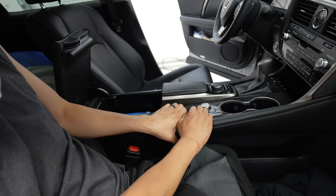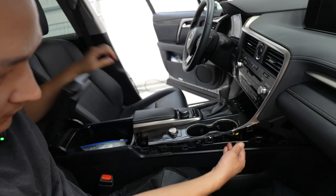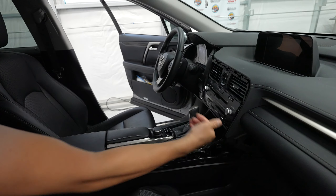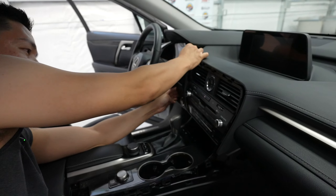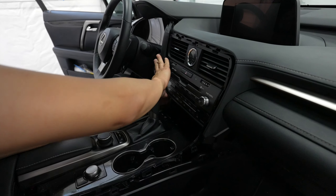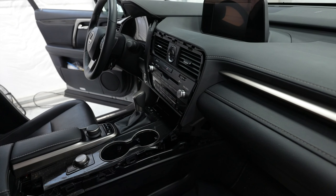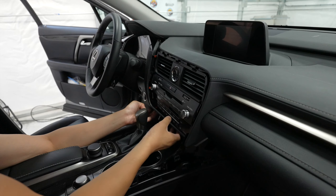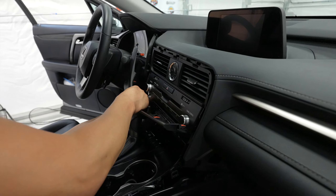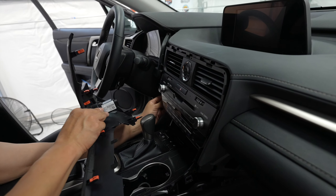Let's go ahead and remove this — with two hands, pull it towards you; it comes off very easily. Let's pop open this and pull it towards you. Before we do that, let's remove this panel piece here — just pry it out, grab it, and roll it towards the driver's side. Then you can remove this. There's a start button here with a little release tab — push on the release tab and pull it out. This line is a bit short so you'll have to reach down a little bit.